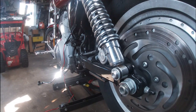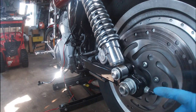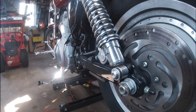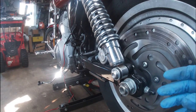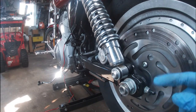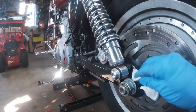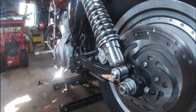They had put a new belt on for the guy I bought it from, so this way once we back this off three full turns, we back off the other side three full turns exactly. Then we pop the clip, remove the nut, pop the axle out, and the wheel drops off. The main thing you're doing this for is when you put it back together, you know your belt's adjusted properly — crank it back three full turns on each one and the belt will be back to perfect, without needing a belt alignment tool.